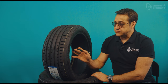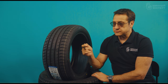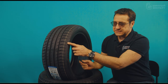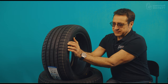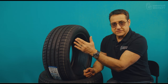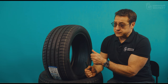From the point of view of the internal structure, sidewall, and markings, that covers it. The tire name implies sportiness, and the profile is squared, but not 100%. The manufacturer left a slight rounding in the shoulder area, making it less harsh and allowing the tire to react to road bumps, thereby being more comfortable. I'd say it's about 80% sport and 20% comfort.